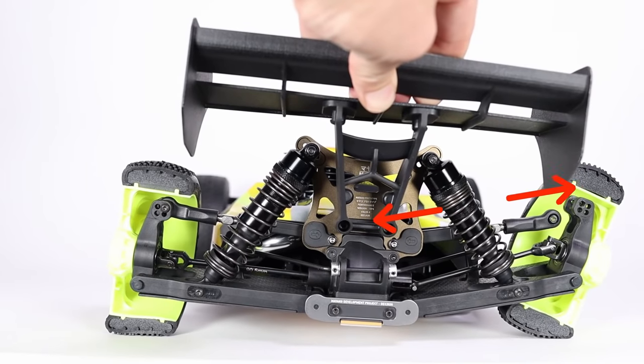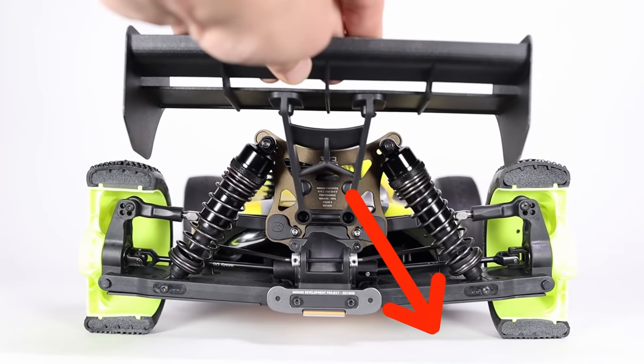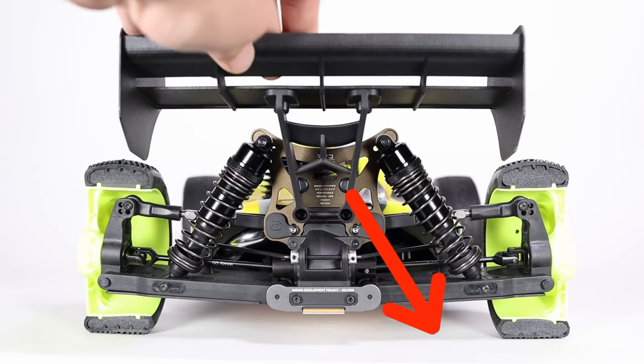The way I understand this, or sort of visualize this myself, is that looking at the car, as the car rolls, the upper link is actually pulling on the car. The fact that the link is pulling on the chassis of the car means that as it tries to roll, the chassis wants to roll downwards. That's how it can achieve roll. But the link is pulling on it. So that's what's causing the geometric resistance to roll. It's not allowing the chassis to roll down.